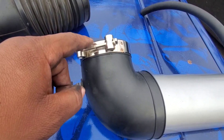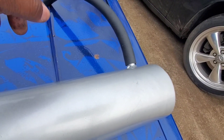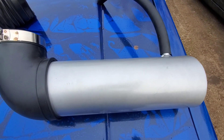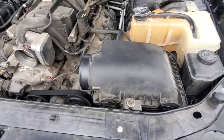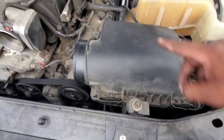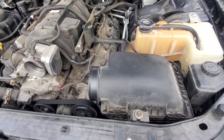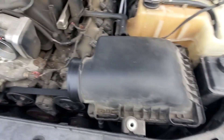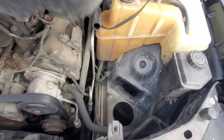Make sure you put your clamps on — that's going on to the throttle body. Got the air vent hose right there. Got the new one on. I might have to cut it a little bit. The next thing to take out is the stock factory box. I've never taken this one apart on this particular vehicle, so hopefully this is the only screw I've got to take out right here. That same hose that's on the new intake is that same one right there. Take that hose off — comes off easy. You can put a clamp on it if you want, but it really doesn't make a difference. Pull that bad boy out.